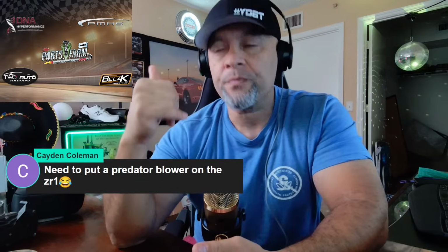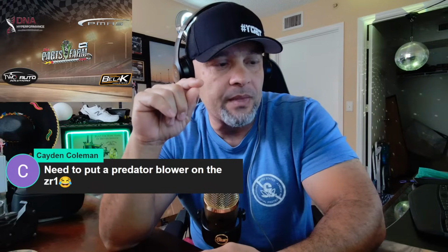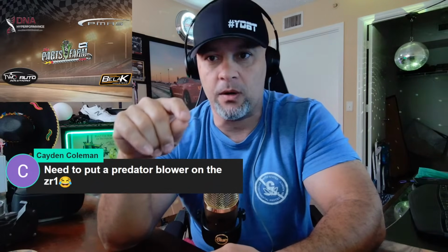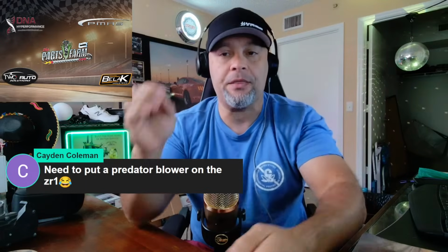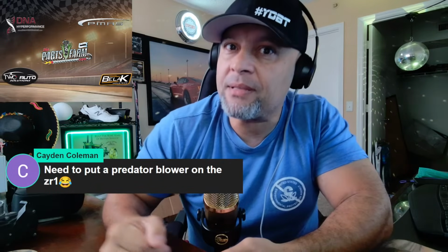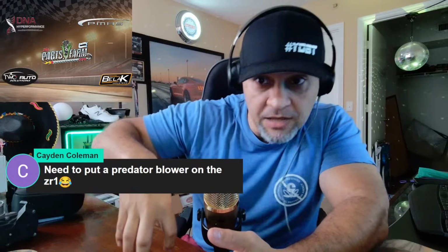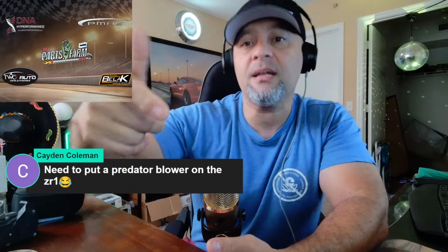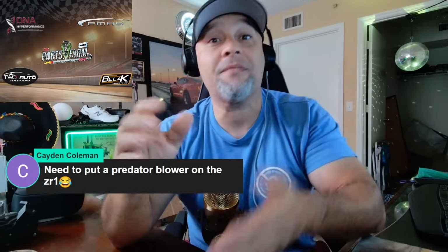That's the other thing. The fuel system is something that I really got to think about, because after watching a YouTuber's video on how the fuel tanks work, how they can come off on the side, but there's a big tube in the front that brings them together. It made me realize that I can tap into the bottom of the tank, but the problem with tapping into the bottom of the tanks is that the fittings are always loose. So it's almost better to have a module in there that pumps through the stock stuff. But I think it's going to have to be like a Fore Innovations fuel system. But I think I can get away with the stock stuff if it turns on.